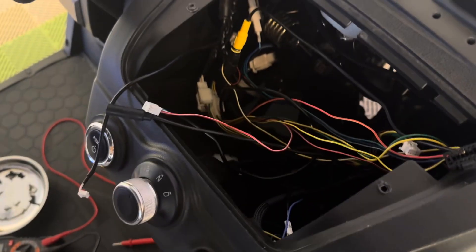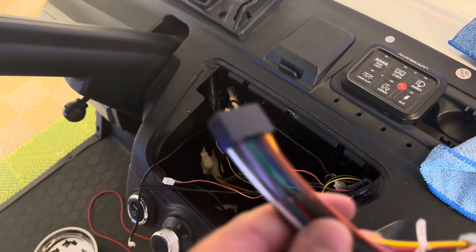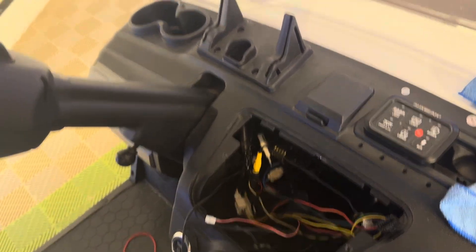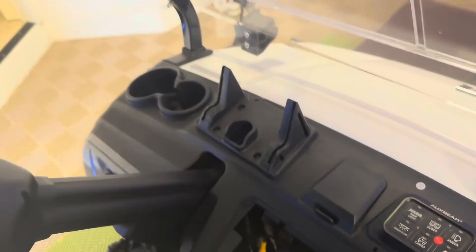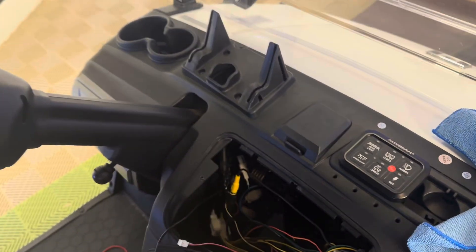Even after adding an extra pin to activate the accessory display trigger, it still makes a ton of howling sounds. The sound bar is producing an insane high-pitched squealing — it's obviously not wired through the traditional speaker wire correctly. So what I'm going to have to do is redo a harness from scratch. I was hoping to just pull the display out, plug in the pins, and have Android Auto — but that's definitely not the case. More research needs to be done; I'll potentially build a new harness and keep going tomorrow.